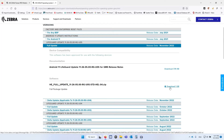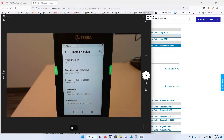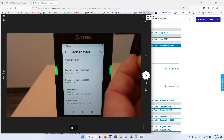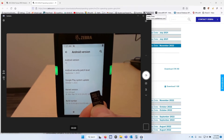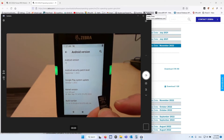I've already downloaded it because that takes a long time. The next thing you need to do is transfer it to an SD card — put that in your PC, download it onto there, then take out your little micro adapter. This is the only size that'll fit inside your Zebra. We're now going to put this inside the reader, boot the reader, and it'll sense the new operating system on the card and install it from there.